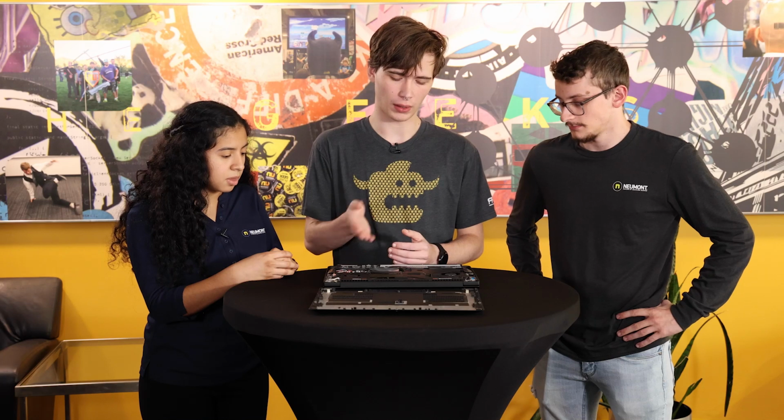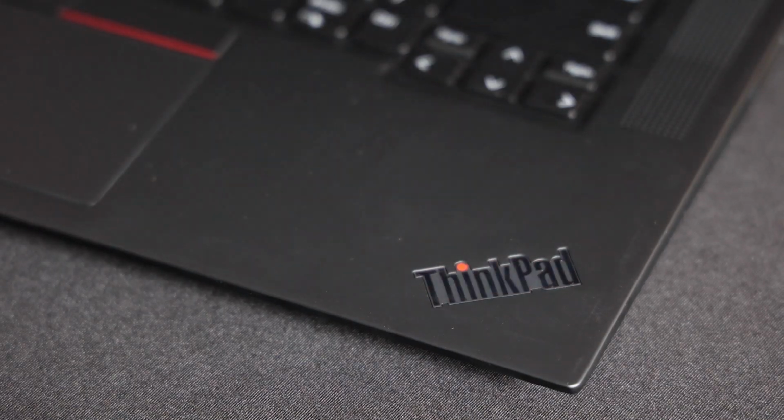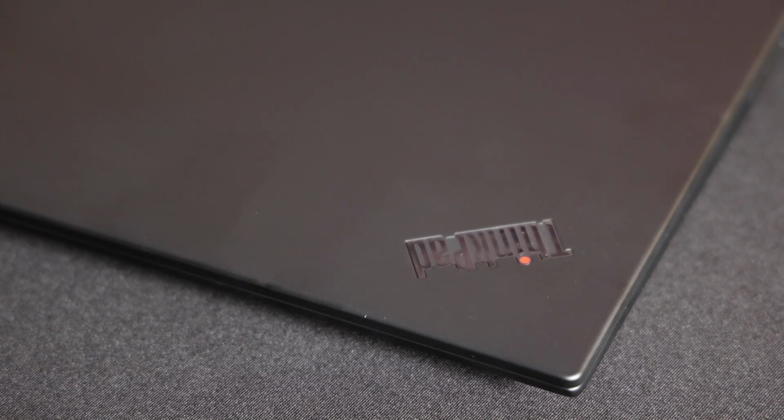All right, Nick, say someone steals my laptop. Are they going to be able to get in and see my 40 Chrome tabs, or what's the situation with my history there? So what's great about this laptop is it comes equipped with a TPM module. So what it'll do is it'll encrypt with the Opal module on the SSD. And so the two are going to have a handshake. And so if they try to steal your laptop and say they want to replace your hard drive with theirs and read, say, your hard drive on a different machine, they're not going to be able to read your hard drive. It's going to be encrypted and all of your data should stay safe. That's what I like to hear, Nick.